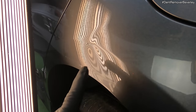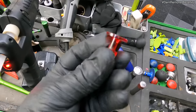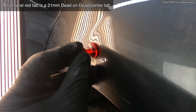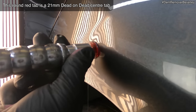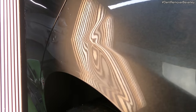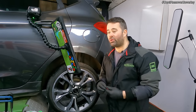Let's try another one. This time I'm going to go down here a little bit using a smaller tab. Going to pop that onto there and see what happens. Slide hammer on there again, finger on the end. Very good. So there — from a couple of glue pulls — making really good progress already.